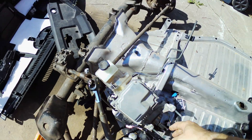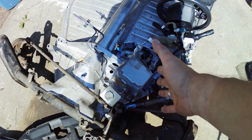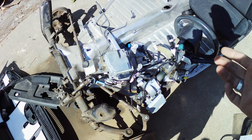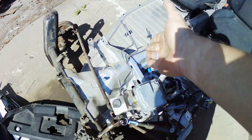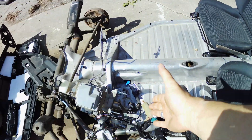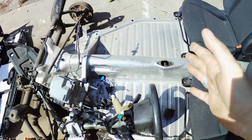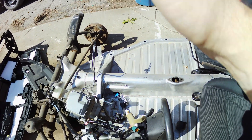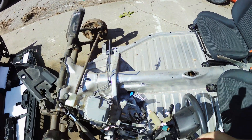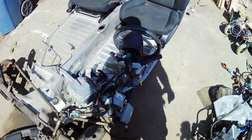This is the brake master cylinder, because the Leaf has ABS. The goal is to make that work, but obviously it's not going to fit right in the old spot. The nice thing about a brake master cylinder that doesn't fit in the old spot is that all you have to do is press in that lever — this part right here. So it could be a lever above it, and as long as the pedal ends up where the brake was, you press in and the brakes work.